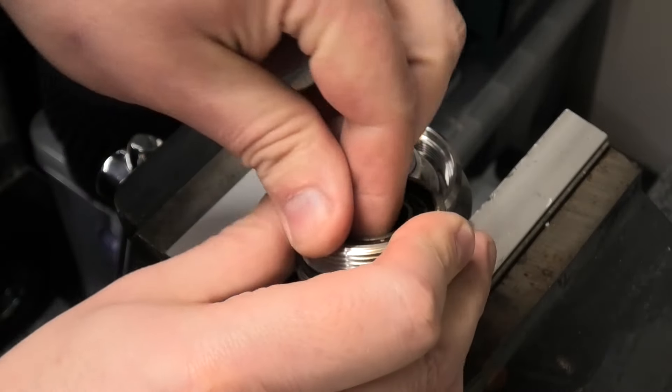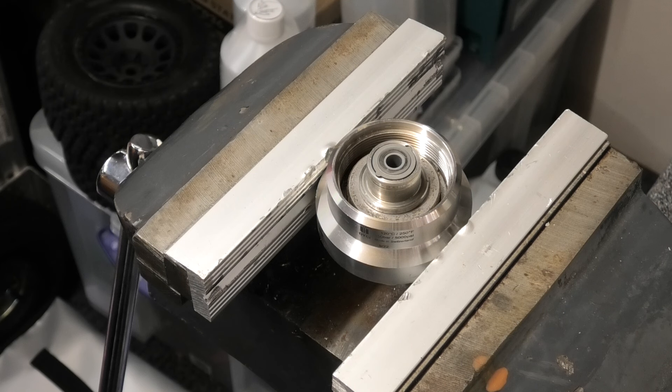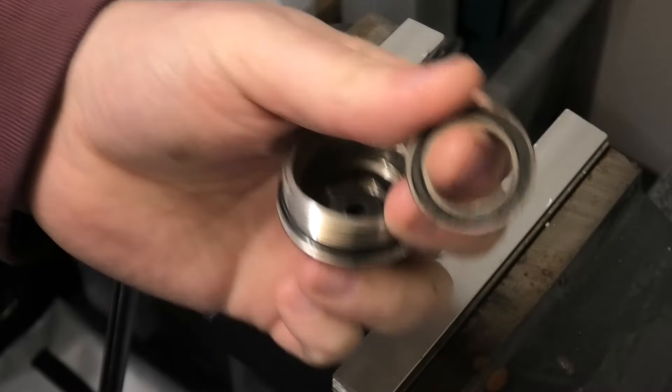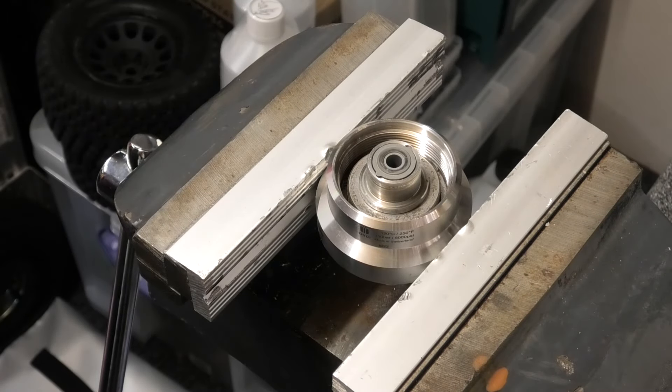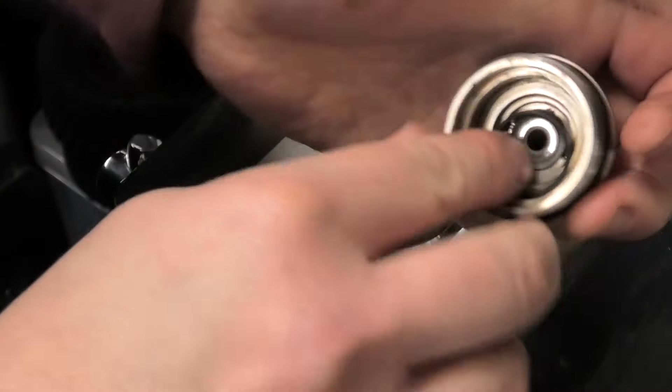Inside there is your common run-of-the-mill roller bearing. They can be quite hard to get out — this is where you may need a slide hammer with a blind bearing puller. I'm just wiggling it out off camera to try and relieve it. Since I've had this out previously it should just pop out, but you may need a slide hammer with a blind bearing insert. There's no way of getting it from the other side without potentially damaging the seat. You can pop the carbide insert out. There's the bearing out — this one is actually still in quite good condition, but since you're going this far, you may as well just replace the whole lot.